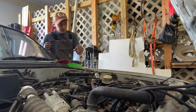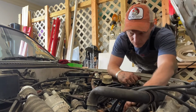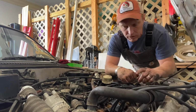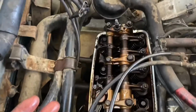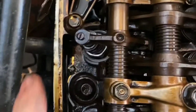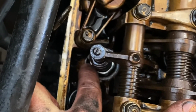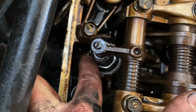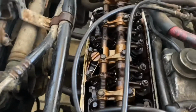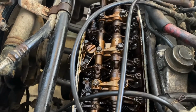You see that? That was coming from this auxiliary valve, or close to it. So, like I said, all of these are adjusted, and this is the auxiliary valve that's giving us some issues. I'm getting some sort of fluid, either oil or gas or both, it kind of smells like both, out of here. And I think it has a compression ring or some sort of O-ring, which I've already ordered, basically a rebuild kit for it, and a spare valve just in case. But I don't have it.